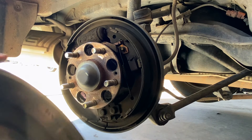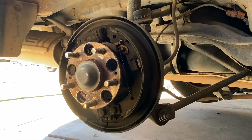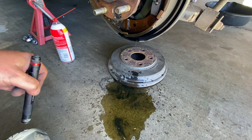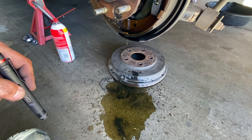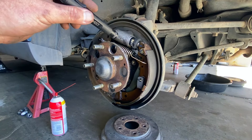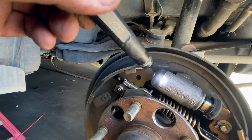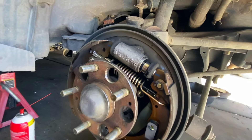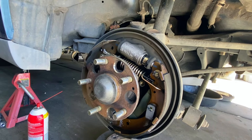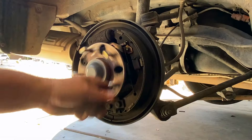There's a bunch of dirt and contaminants in the bottom of this, so do your best not to bring that in. Here's our problem right here — we can see the dripping of brake fluid in the rear. Old wheel cylinder here has decided to pop off. As you can see on the other side, that boot should be there but it's not — that's leaking. So we need two wheel cylinders; the other side is doing the same exact thing.